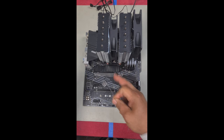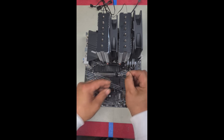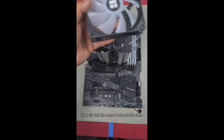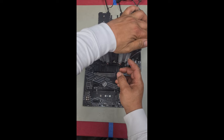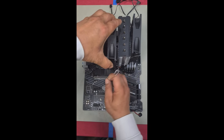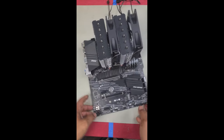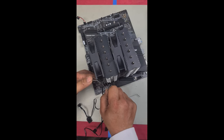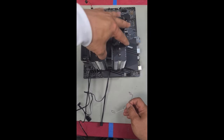Now install the fans onto the fins. Clip the fan clip into the holes furthest from where you're clipping it onto the fin. Push the clips into the fan, sit it over where you want it, and pull it over until it clips over the fins. Take care of one side first, then do the other. Push it through your screw holes and clip it on. Turn the cooler around and do the same to the other side — push the clip into the screw hole, bottom one also, and clip it over the fin. Do the same for the second fan.